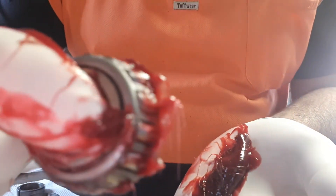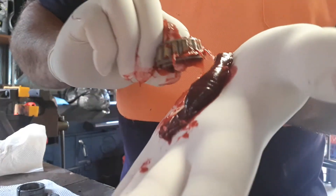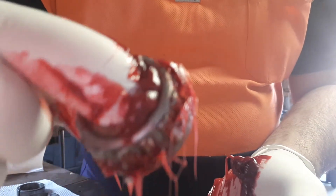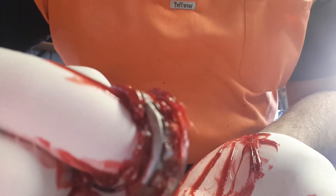I'll show you again with the small bearing — same thing. A glob of grease, feed it through, so you're coming out the back. You can't overdo the grease, just give it a good knead. Don't worry how much is on your hands. All coming out the back.